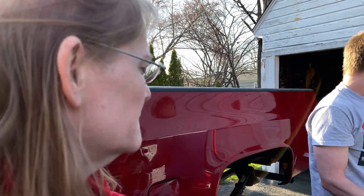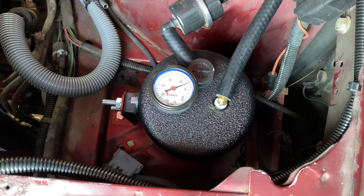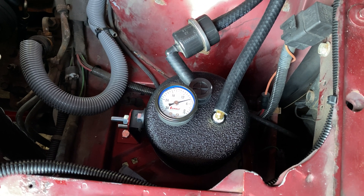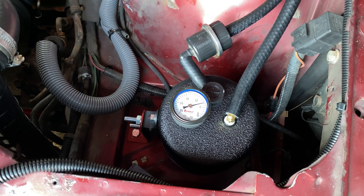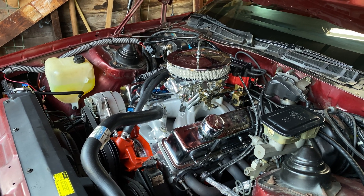So what do you have to do now? You could put in a vacuum pump — it can either eliminate the hose going to the intake or be plumbed in between. Not exactly sure how it needs to be wired or plumbed in. You just need to add a vacuum pump. The reason for trying the canister first was to see if it did anything before buying a pump — why spend $200 if you don't need to. When they got home, the pressure on the gauge was 10, which is perfect for power brakes per the sheet. So it's possible it's helping, but just not enough. Matt said it actually worked a little bit on the first stop, but if he had to stop again quickly — like in traffic inching forward — it wasn't good because it didn't build up enough pressure. But for now, they're going to call it a day. Thanks for watching and have a great day.